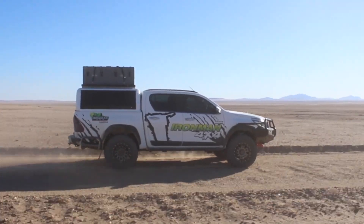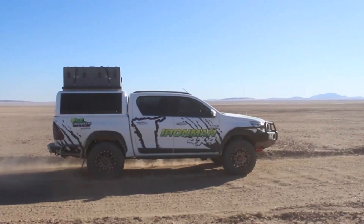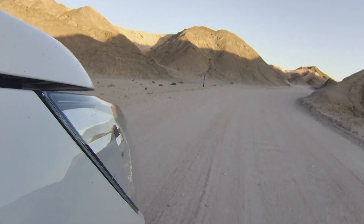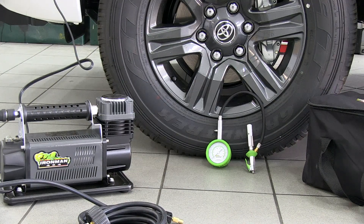If you have 4x4 on your vehicle, use it on the gravel road — the vehicle has been built for that purpose. It ensures that when you go into a corner or a turn, you will always have traction. When you're on a gravel slide, if you apply some throttle, the vehicle will grip and carry you through that sharp corner or turn. When you get off the dunes, ensure that you have a pump available to immediately inflate the tyres to the correct pressure so you can safely travel.